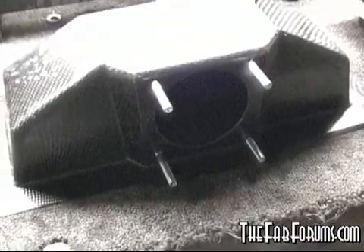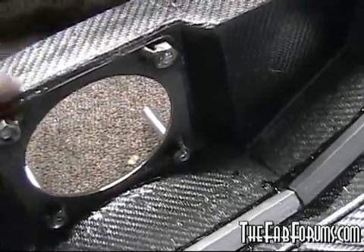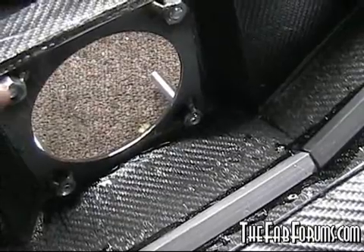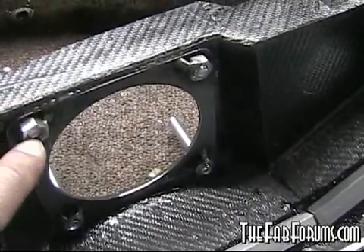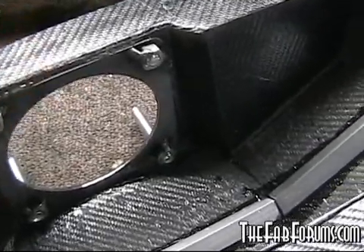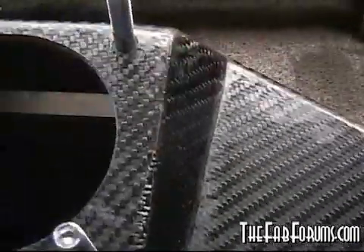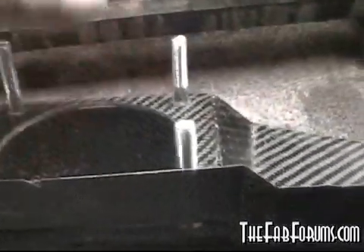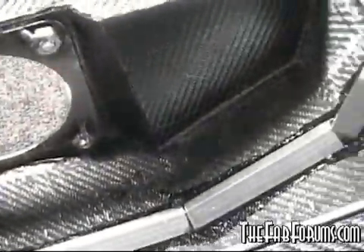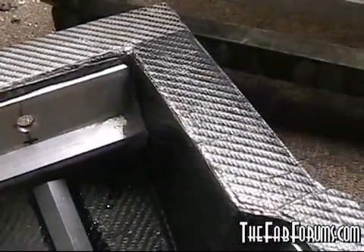On the upper, as you can see, we have screw-in studs. On the inside, there's a steel plate — probably about a sixteenth of an inch thick, nothing real thick. I made a steel plate, welded some nuts on there, and then epoxied the plate to the inside of the carbon fiber intake. You just screw right in, and when the throttle body's on there it's going to sandwich all those layers together.